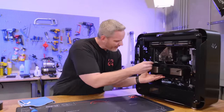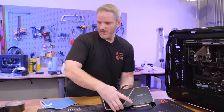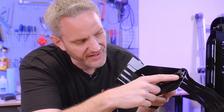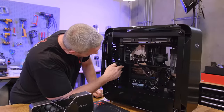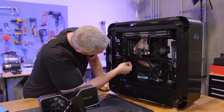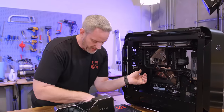So as neat as it would be to say the cooling will be a little bit improved, I'm going to go ahead and just go back to what I know is working, which is mounting to this vertical mount. I'm not going to be able to change out this vertical mount — I don't know if it's PCIe Gen 3 or 4, but these mounts are very specific to this plate and the way that it adjusts on there. So I'm not going to be able to switch it out to the Gen 4 riser cable that I have because it won't mount down on there properly. So I need to put this back on there. We'll get the graphics card mounted back up in there, I'll show you guys what it looks like in case you've never seen my personal rig complete.